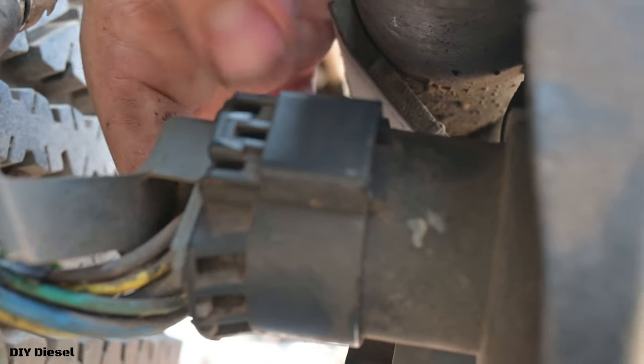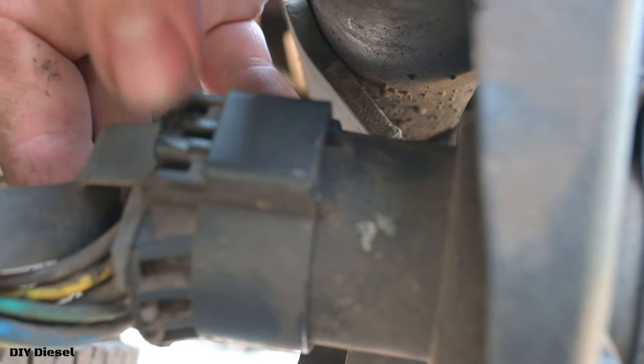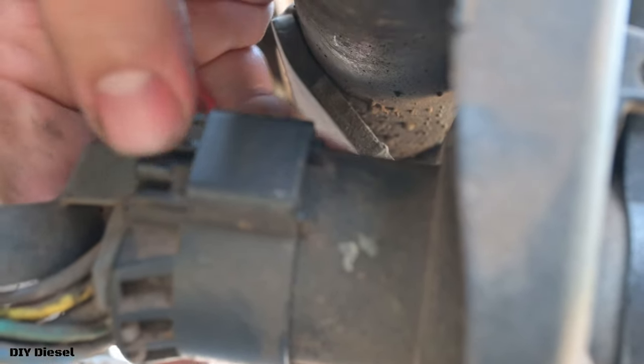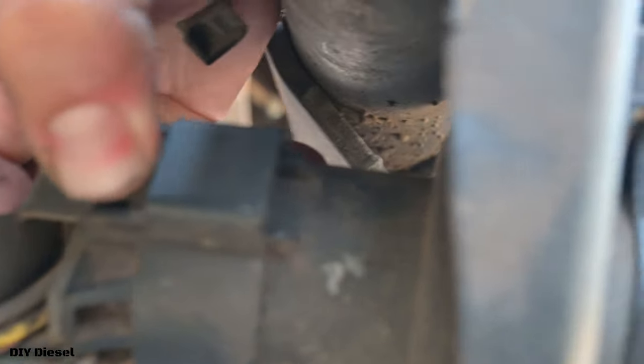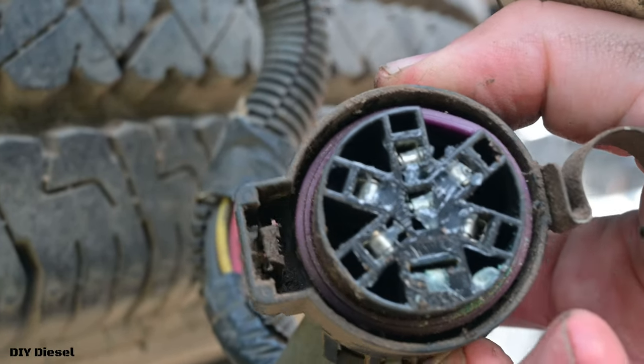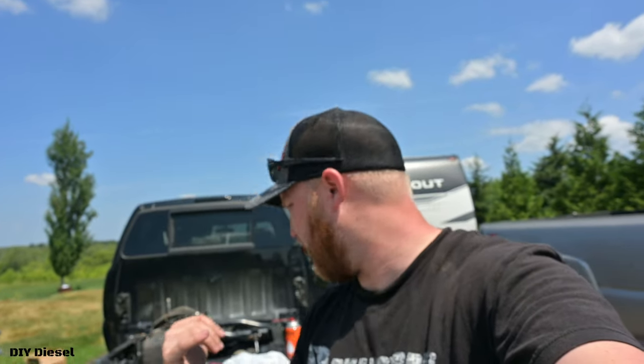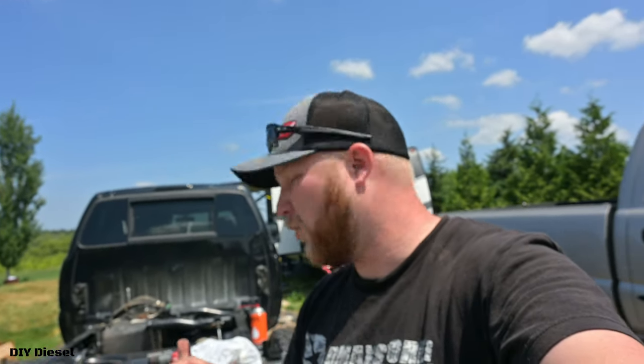On the back side you're going to have the factory harness plug plugged in just like this. It's clipped — all you have to do is push it in and it'll wiggle right out. You can see it's got dielectric grease in there, and I'll show you that we're going to reapply that on our other harness. Since it's already done on this truck, I wanted to show you how to remove the factory one if you have it.